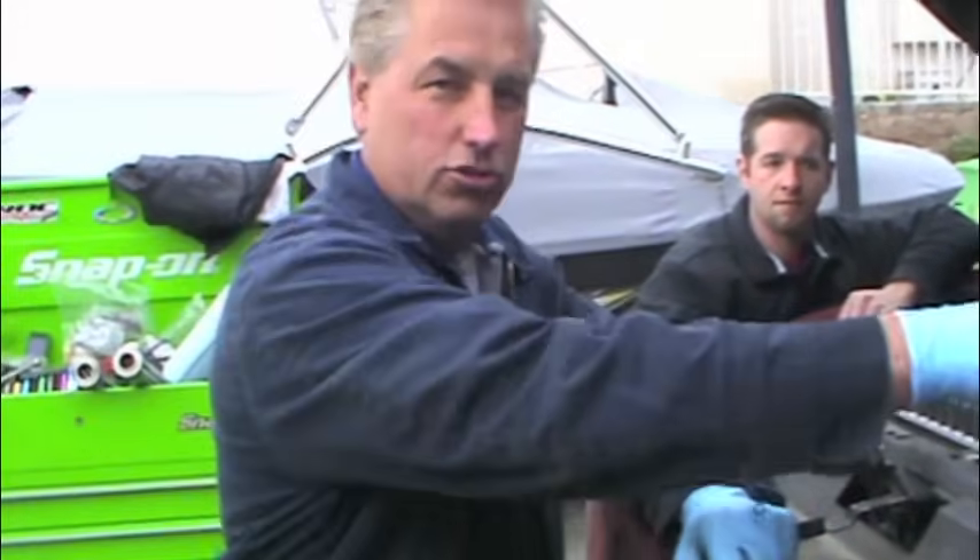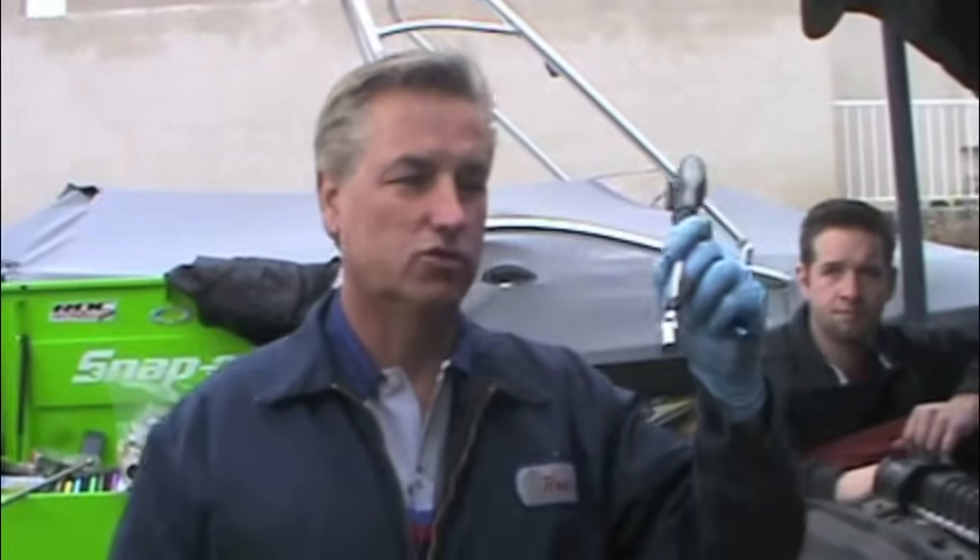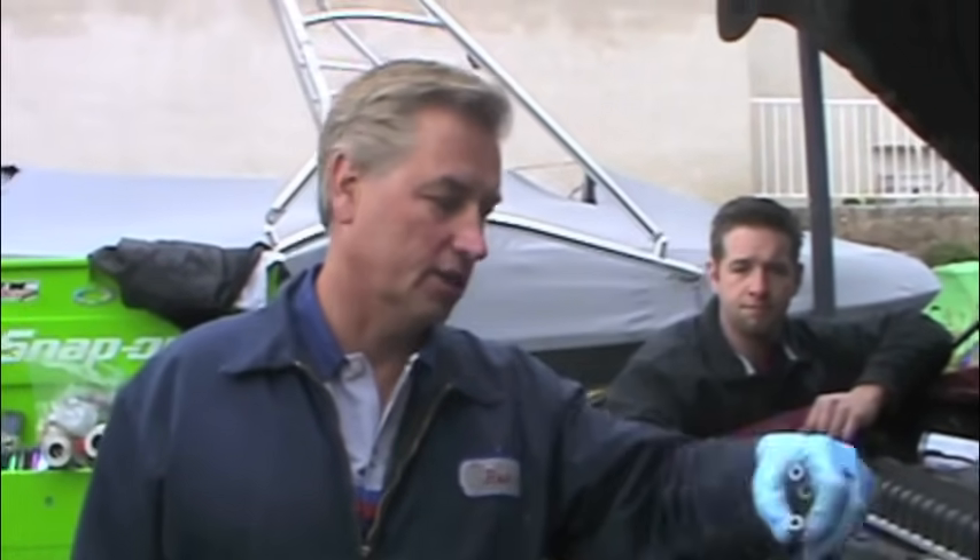What I like to use: I use this 12-volt Milwaukee ratchet — it's really good. I don't have the hose dragging all over, it has plenty of torque, removes everything. And then I also use a 2-inch quarter drive extension with a 10 and a 12, a 12 swivel. That's for the very back bolt, and I'm talking about the driver's side right now. Then I'm going to use the 30 Torx to get the fuel rail off.